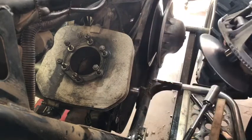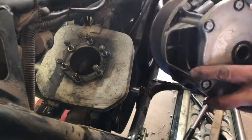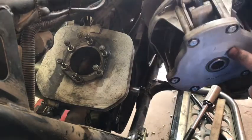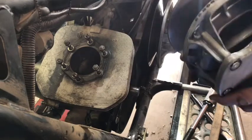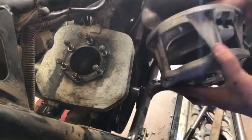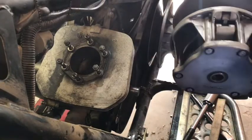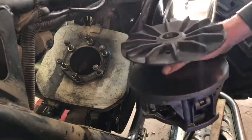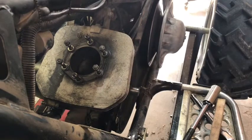A lot of cases these will be marked on the crank, but in this case there's no markings on the crank — you just hope for your clutch to be balanced. The clutch components, however, are marked. The spring face, your ramps — everything else is lined up with X's. Generally, let's see if this one is, or if somebody's had this apart and not remarked it. Hard to tell. But before I put it back together, I will clean it, service it, check the ramps, check the rollers, check everything over, and then use it again on the other engine. So that's the primary off, in case you guys were wondering how that comes off. Put that away and we'll stick that primary bolt in with it so we don't lose our parts.